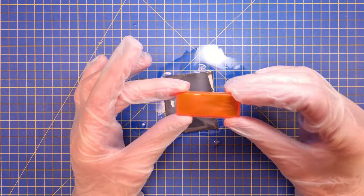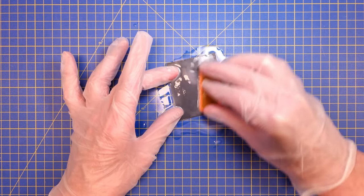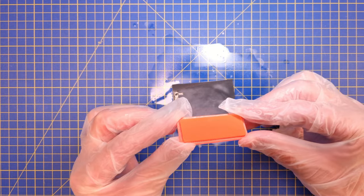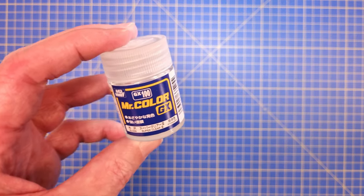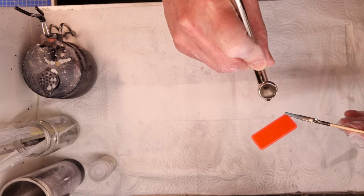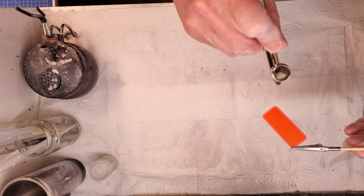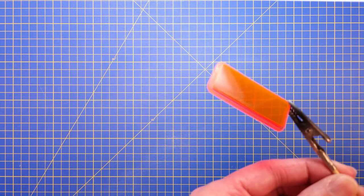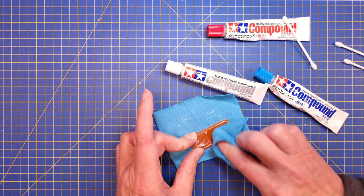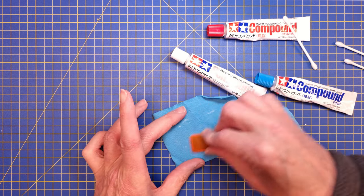First I need to unify and flatten the surface with wet 1000-grit sanding paper, and after cleaning up the mess the next step is to coat the surfaces with a clear coat. Since my second hobby is scale modeling, I have lots of stuff for doing things like that. I'm using a transparent glossy varnish thinned with lacquer thinner, applied with an airbrush in a thin layer. This clear coat is quite smelly, so I have a spray booth with forced ventilation. After curing for 24 hours, the lens looks quite good, but we can improve the sheen a little bit by using a polishing compound — the kind that scale modelers use to get a nice glossy surface on car and motorcycle paint jobs.